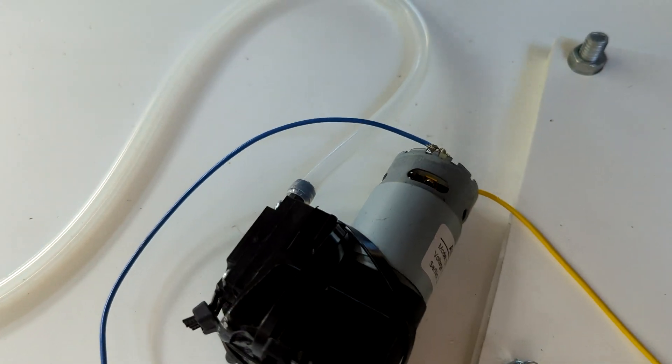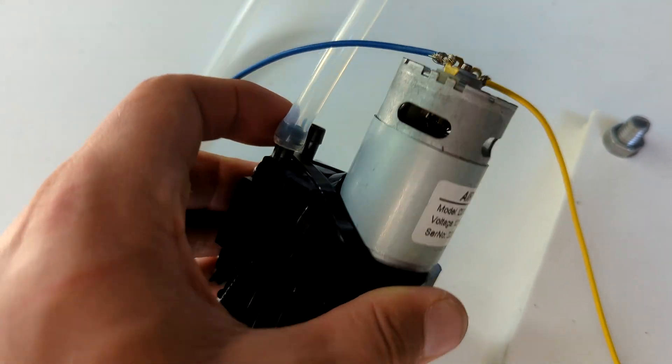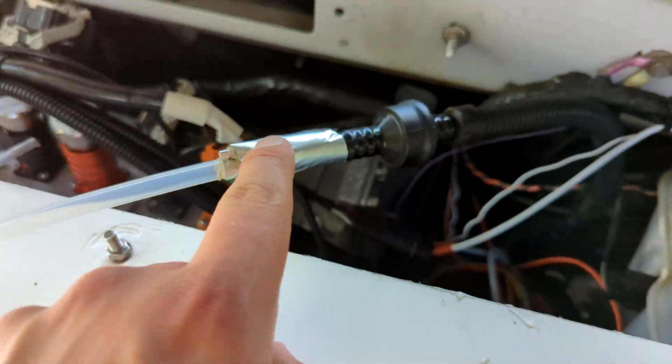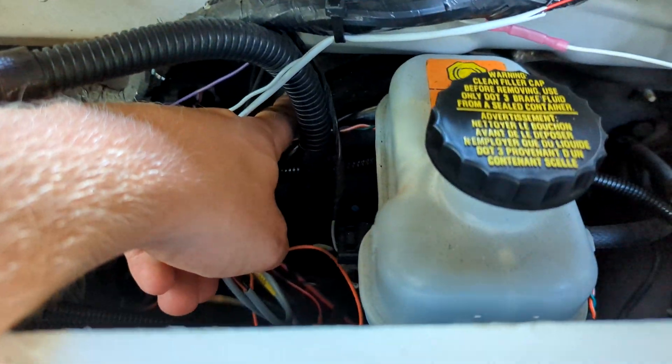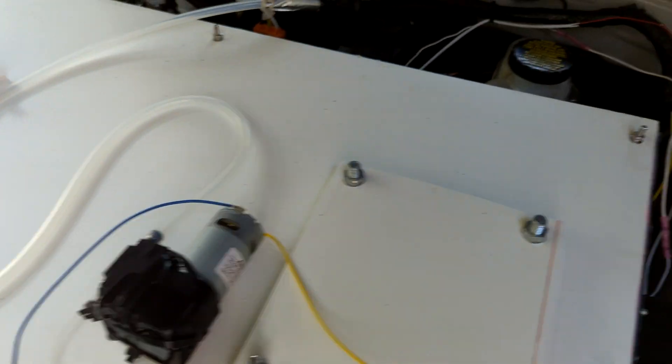It's about $25 on Amazon. This is the vacuum inlet and that's the air outlet. I've got the vacuum line hooked up — I just used some rubberized tape to hook it up to the vacuum brake cylinder, which is this big black metal cylinder back there. You can kind of see it. So I'm going to power it on and show you how that works.